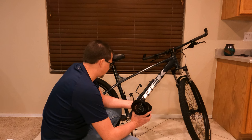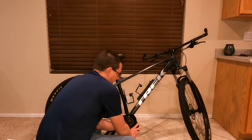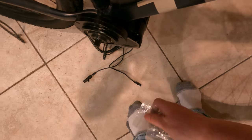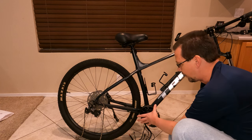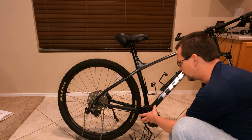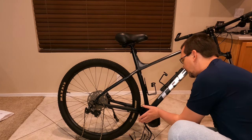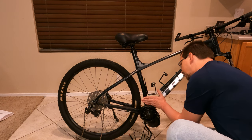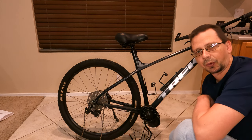At this point we're ready to do a dry fit to the frame, see how everything fits. We just put it right there and slide it into that hole, add a couple of washers to hopefully keep it from rusting against the frame. Looking at the chain ring, I can already tell I should not have downgraded to the 36-tooth — I should have stayed on the 42-tooth chain ring because the chain line is definitely going to be off.